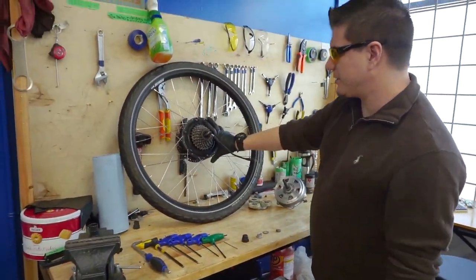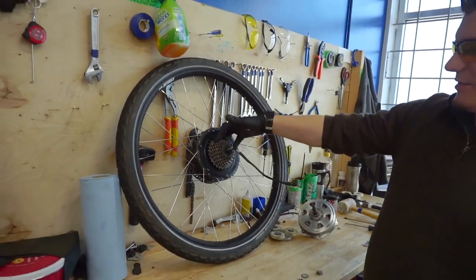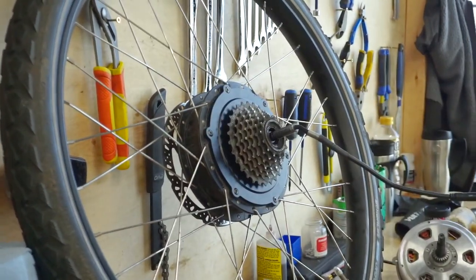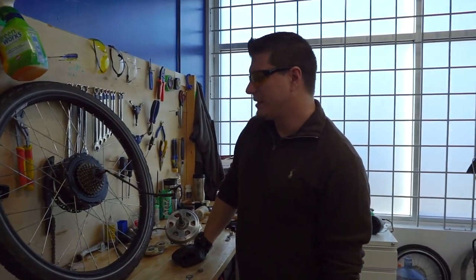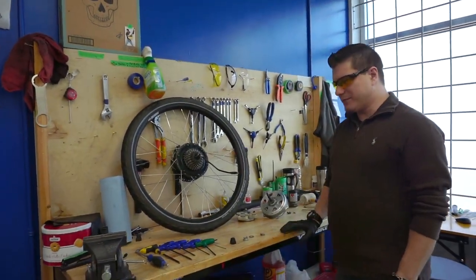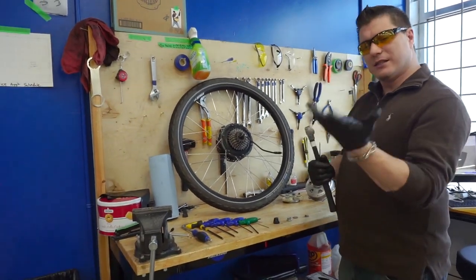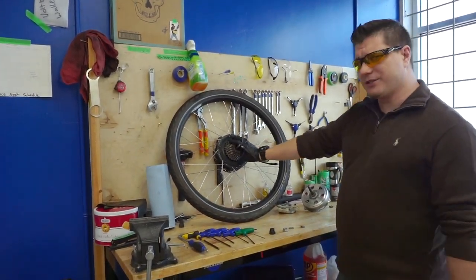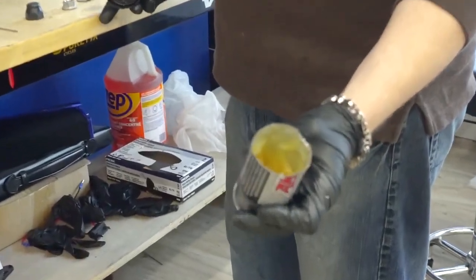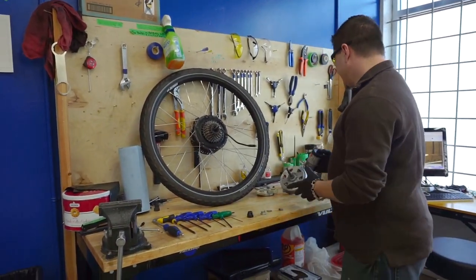I chose this particular motor as a reference because we've had some issues with the axle sticking on the exterior bearing. This is a problem you may or may not encounter during motor core removal — I only see it in about one percent of removals, so a little persistence will ensure success. You may be swinging a hammer against metal, so ensure you wear safety glasses. Rubber gloves are a good idea. If your motor is high mileage, have some lithium grease on hand — it goes on the inside and helps repel water. If it's a warranty swap, it should already be pre-greased.